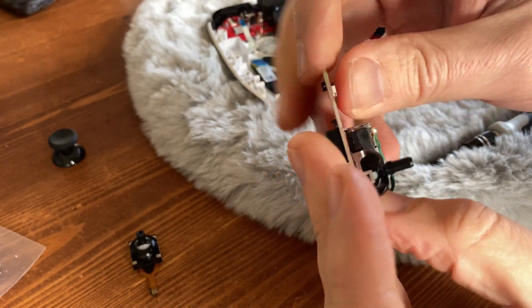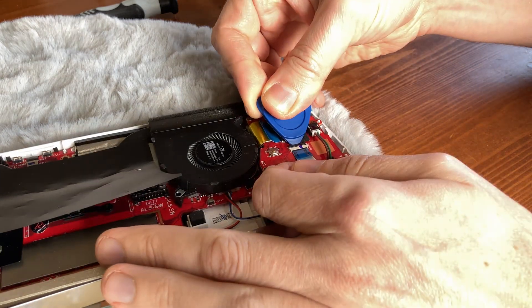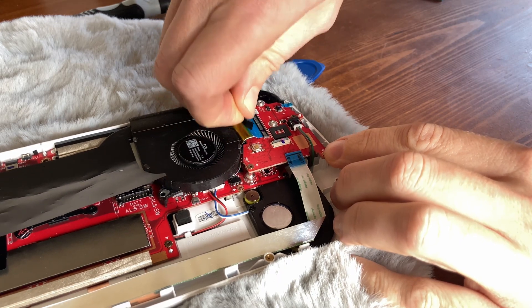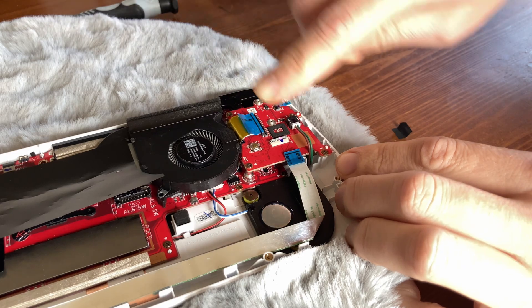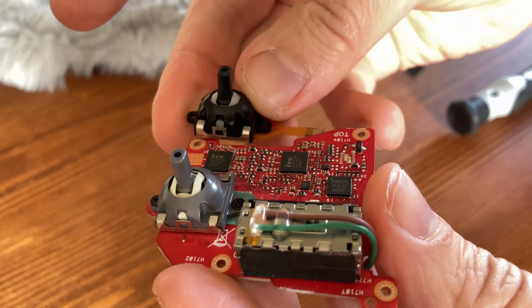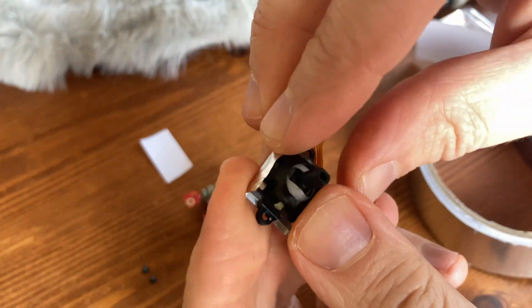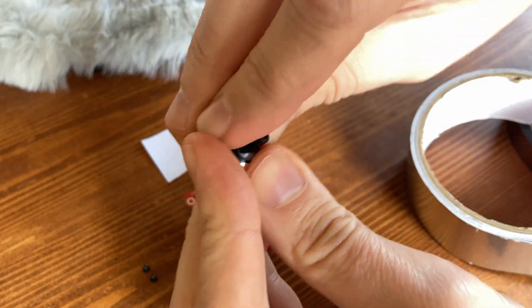Now that the right stick is done, we can move to the other side. It's basically the same over here, but there are three ribbon cables rather than two — one at the top, one at the bottom, and one in the middle under a rubber piece. Once out, there are four screws to remove, and then we can remove the module. Both sticks share the same dimensions, but as the stick is close to the L2 trigger, we need to shield it from the other magnet. Stinner's video guide does this by sticking on thin strips of aluminium tape.